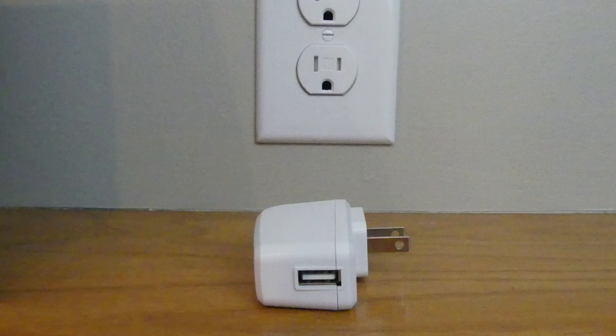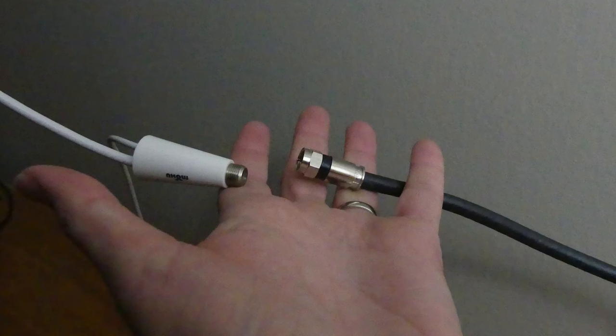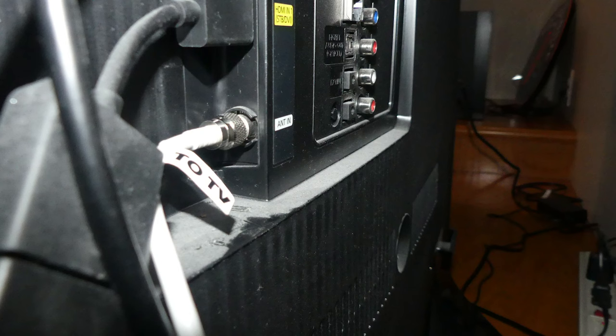We get great reception pretty close to our TV, so we don't need it. Now we actually have a Mohu Curve, which is a solid frame and base, and it's a little different than the Leaf, which is thinner and flexible. If you buy the Leaf, you also get some sticky tabs that you can use to stick the antenna to your wall — Mohu even says these are paintable, so you can paint it to match your wall. You'll also see a power adapter in your packaging. We don't use ours because our TVs have USB ports, so we just power the antenna through the TV. If your TV doesn't have a USB port, you can plug your antenna into the wall. Then you screw one end of the coaxial cable into the back of the antenna and screw the other end that says 'to TV' into the coaxial receptor on the back of your TV.